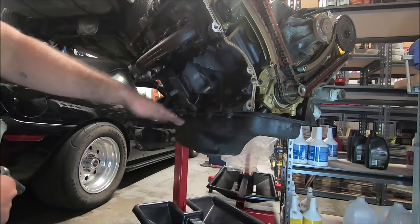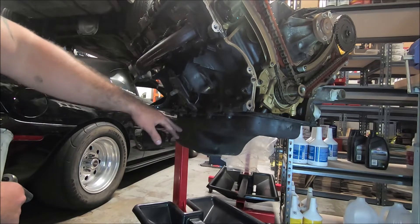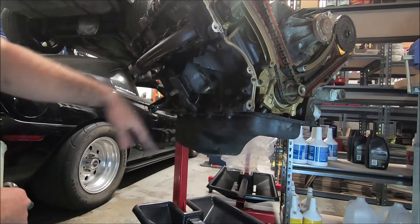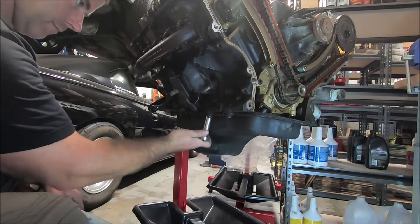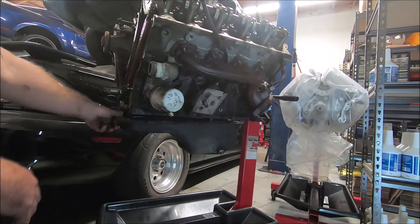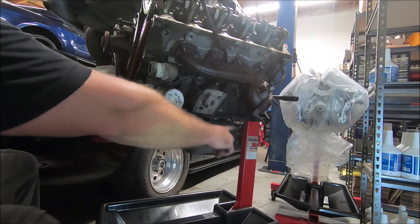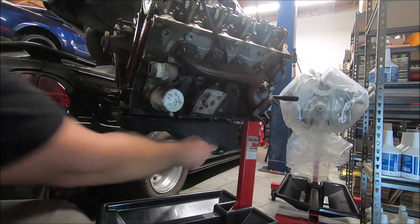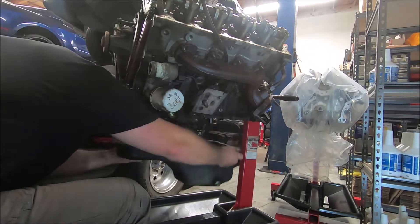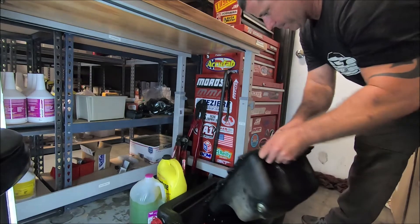Now I'm going to unbolt the pan, and when you do this it's a good idea to keep the engine upright. That way if something happened and there are shavings inside the pan, they don't fall up inside the engine. I like to take the oil pan off with the engine in the upright position. The pan's already coming loose — remember we drained the oil earlier. I like to leave two bolts in there barely hanging so I undo those last and then lower it down.